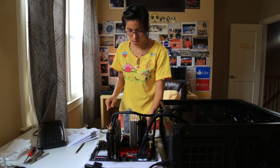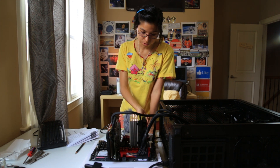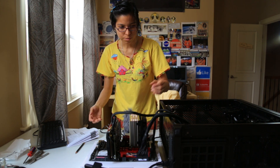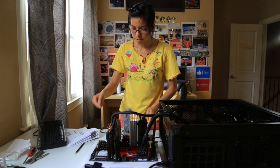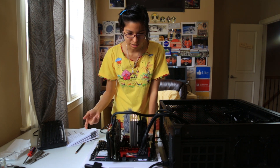Put that USB into the flashback port. Only one slot is for a BIOS flashback, so you want to put your USB in the right slot. Then provide power to the motherboard — that means the power supply is on and you can see the light on the power button and the reset button.